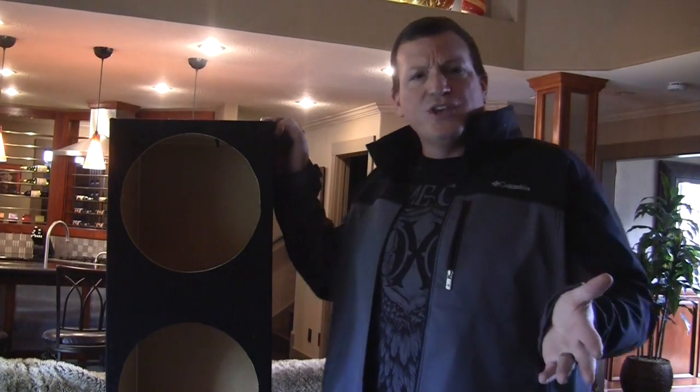That's why at Outrageous Audio, we don't do a lot of custom boxes. People will come in and say, oh, I want the custom box on my wheel well over here. But we explain the truth to them: as soon as we put a box in and it's this thin, you lose half your bass. So you're going to spend hundreds of dollars to make it look cool, but it's not going to sound right. And once we tell them that, they go, oh, well, really? I go, and we can just put a box in that we can disconnect very easily.